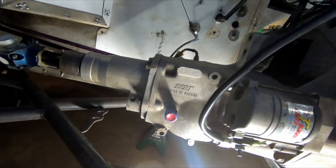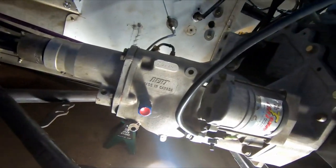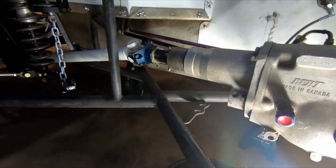Now inside that transmission, it has a built-in clutch inside the body. That bleeder is for that clutch. With this setup here, we have the reverse-mount starter and the bell housing. This is a ball spline. On the back of the transmission where your drive shaft would go in, there is a captured splined receiver - kind of like on the front end of your differential where you put the drive shaft into. Instead of having a yoke on the front of the drive shaft, you just have a U-joint, and you pocket that into that little U-joint cradle, then put straps on it. It looks like the rear end only behind the transmission.